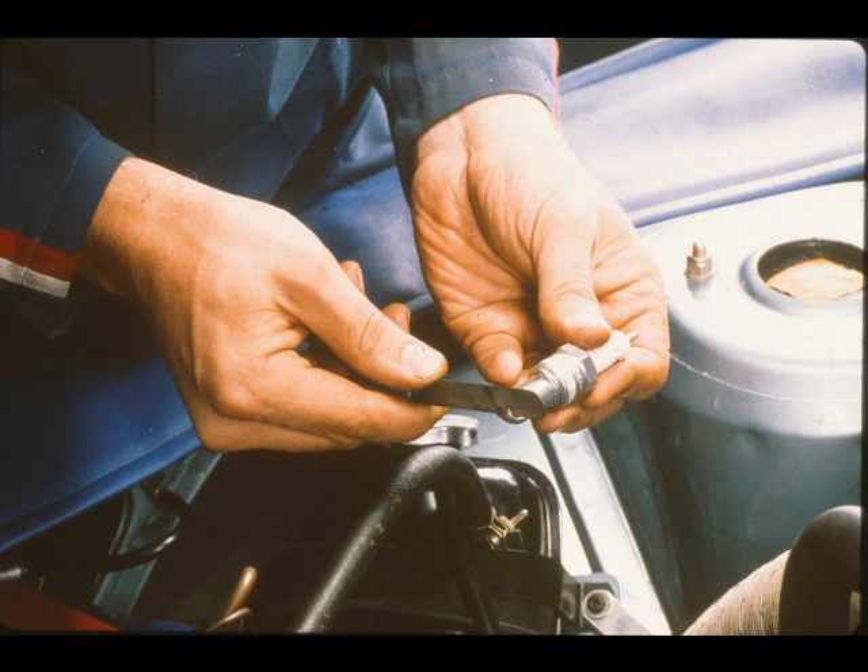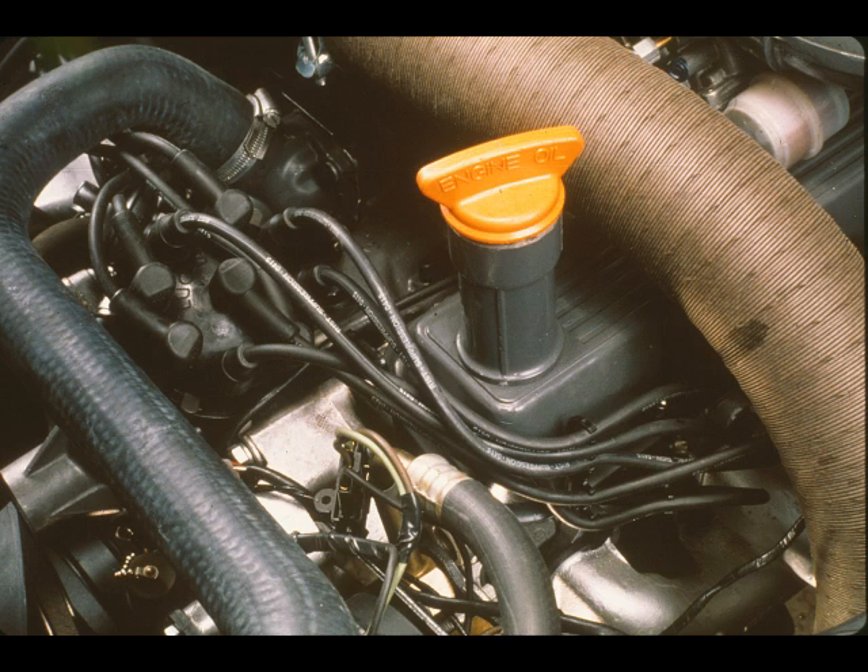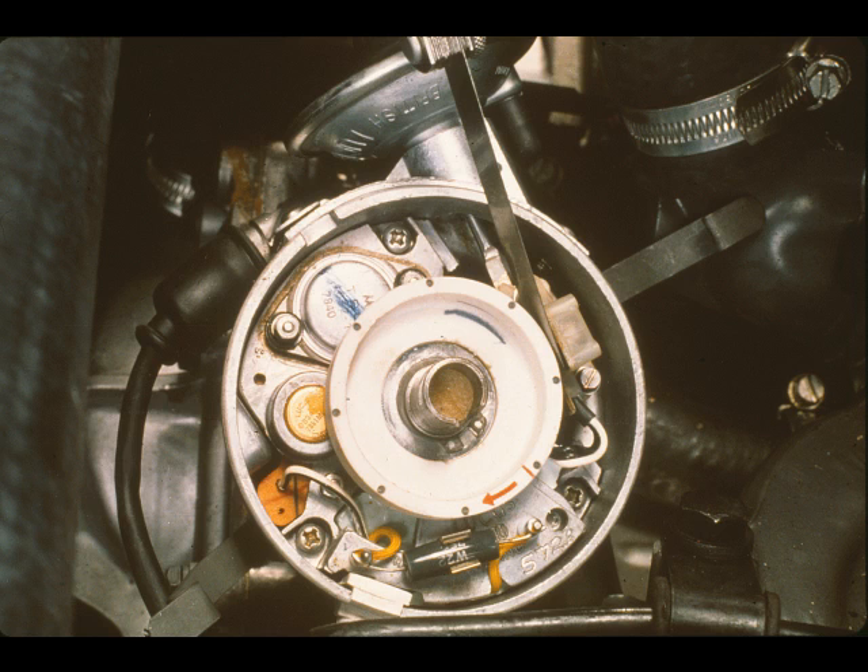Now troubleshooting. If misfiring is the problem, the initial checks are the same as for conventional ignition systems. Make sure that all connections are clean and secure. Then check the condition of the plugs. Look for signs of tracking or damage to the components of the HT circuit. Next, with the ignition switched off, check the air gap between the rotor and the pickup module. One cause of misfire is a broken lead between the pickup and the amplifier, which has been known to cause an intermittent connection. The fault can be proved by removing the vacuum advance pipe to prevent the pickup moving.